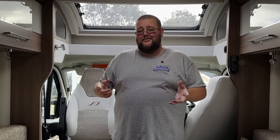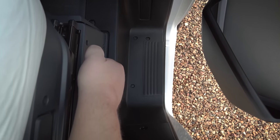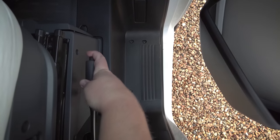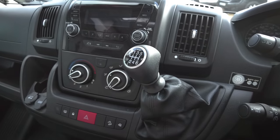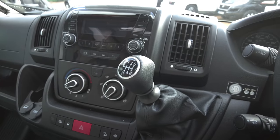As soon as the weather changes, all of these can greatly affect your motorhome. Start with the basics: first and foremost, turn off your gas and potentially disconnect the bottle if you're confident doing so — there's no need for it to be connected over winter. When you park up, don't use the handbrake. Put it into first or reverse and use wheel chocks — a couple of bricks will do — to prevent brake damage and sticking.